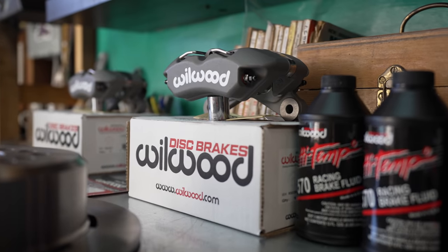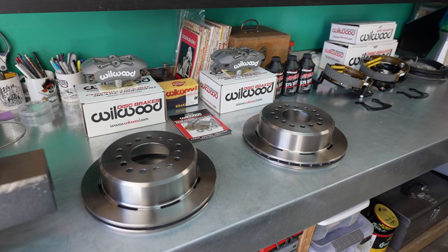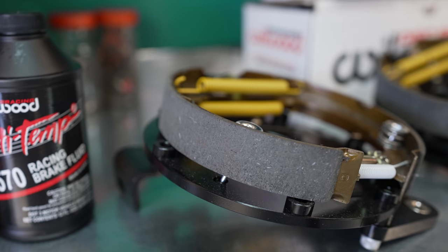What's going on, you guys? Today's super exciting — we're going to be collaborating with Wilwood again and we're going to be installing one of their rear disc brake kits on my 1965 Mustang. It's going to be a huge upgrade to the car. I've been so sick of drum brakes. I'm specifically going to be putting on Dyna Pro four-piston calipers, and the cool thing about this kit is that it has an internal drum mechanism that hooks up to your handbrake.